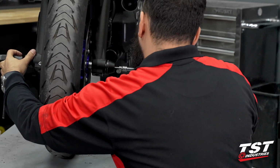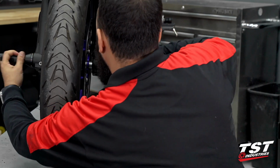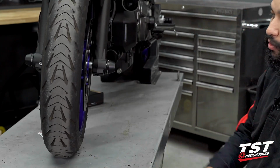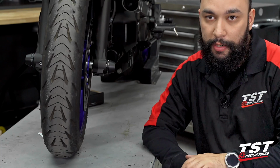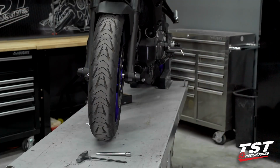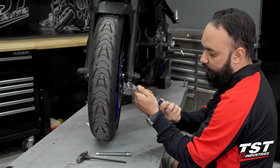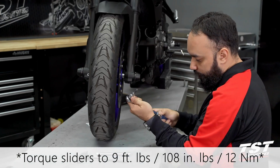Again, we do have torque specs. The goal of this step is just to bottom it out. Now you can go ahead and grab your torque wrench, and we need to torque both sides down to 12 Newton meters. So let's go ahead and do that. With our torque wrench in hand, in case you haven't used one, it should be set to 0. We're going to turn this to 12 Newton meters,